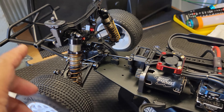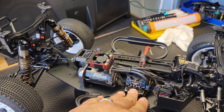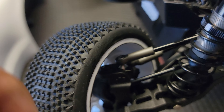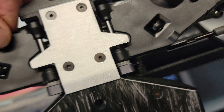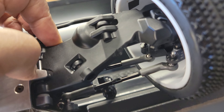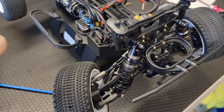My car was really loose in the rear. I didn't change anything drastic — I started with lowering the punch level a little bit for my ESC settings. I also did not have the stopper screw for the steering. Can't really see it right now because the wheels are on, but there's a screw in here that stops this wheel from going even deeper. Without it, you can see this black mark right here — it was biting into the arm of the truck because it was over-steering, which can cause erratic steering. So I put one screw there, no washers.